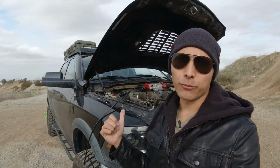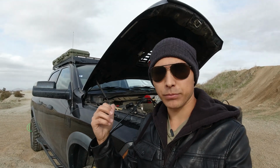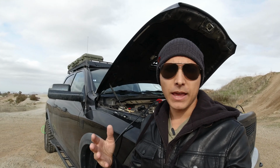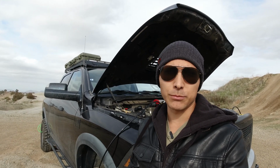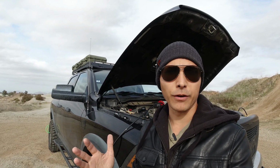All right, so right there you just saw the compressor runs fast enough to where the regulator cannot let enough airflow into the tires at the same time. So the lines for the compressor fill up and it hits the 150 or 140 PSI cutoff, and that tells the compressor to shut off. And then as air goes into the tires more, that pressure bleeds off and the compressor turns back on, and it turns into this real vicious cycle.